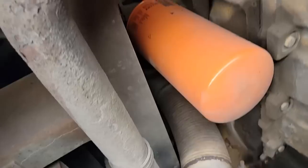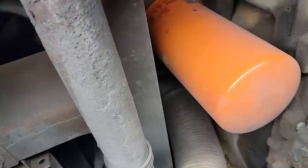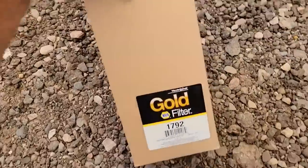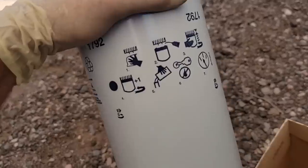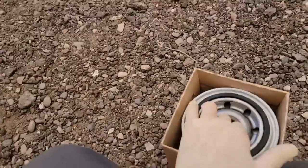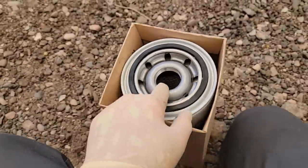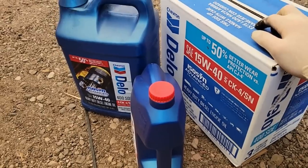While that's draining, what I like to do before I start an oil change is go to the oil filter, get the filter number off of it — this is obviously a Fram filter. Then you can go to the Wix online filter resource tool, put that number in, and get whatever supplier has one locally. I go through Napa and it crosses over just fine. There's the filter I got — 1792. Now this is one of those rare instances where you actually do want to follow the instructions. This filter right here holds about a gallon of oil, and we don't want the engine to go without a gallon of oil waiting for this thing to fill up, so we do need to pre-fill it.